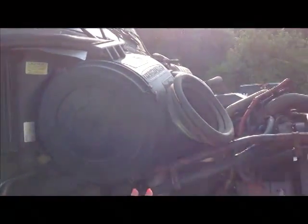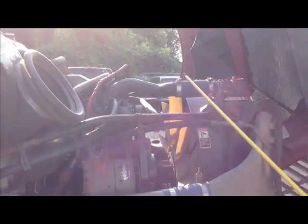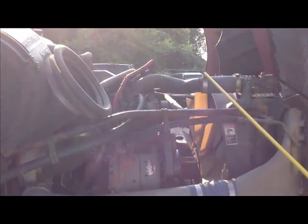The next thing we're gonna do is go to the radiator. The radiator is securely mounted, not cracked, broken, no missing nuts or bolts. Since it has fluid, we have to say not leaking. Hoses, airlines, anything with water, air, or oil, you must say not leaking. So then we're going to go to our upper and lower hoses. They are securely mounted, not cracked, broken, no missing nuts or bolts.